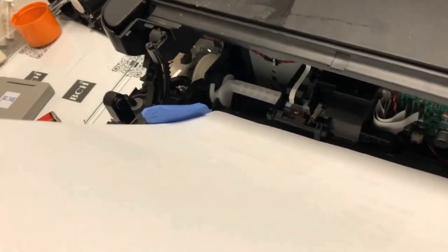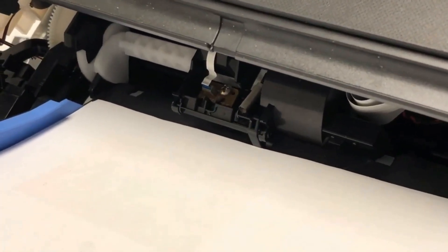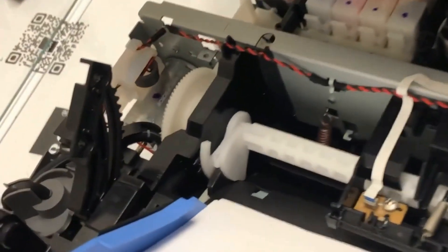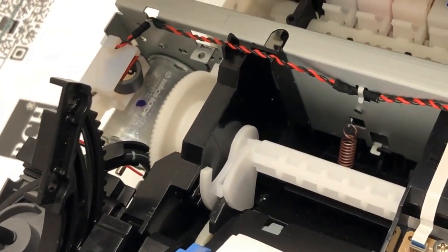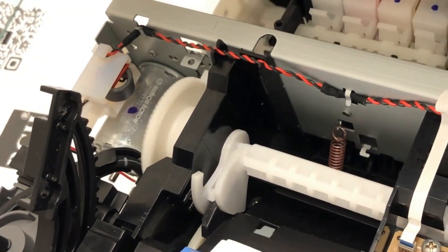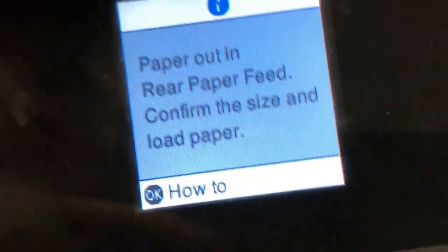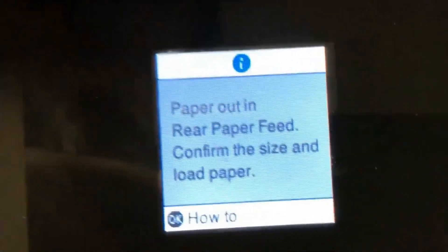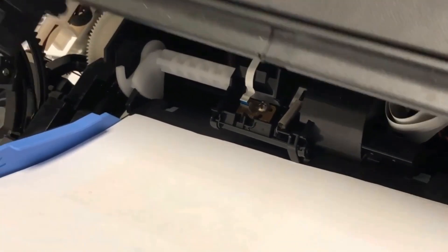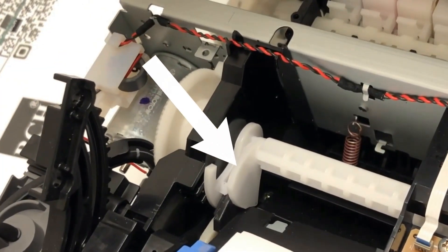To show the problem, I have to turn the back of the printer. The problem is paper feeding. The printer starts okay, but if you send a page to print, you're going to get this — then it's going to stop. Paper out in rear paper feed, confirm the size and low paper. If you look carefully at the gear, you're going to see the gear is actually broken into two right here.